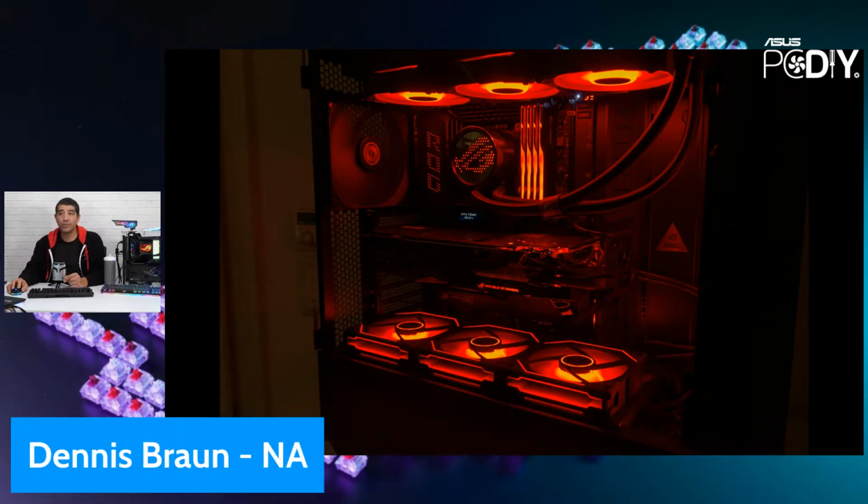Yes, ideally you do always want to match DIMMs, especially even more so in a laptop, because the laptop has much less margin than a desktop-based motherboard. Desktop motherboards are designed to be more accommodating of different types of frequencies, timings, and even voltages.